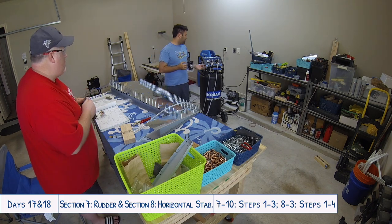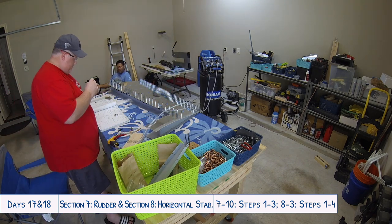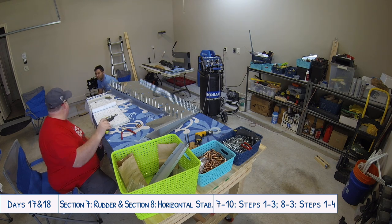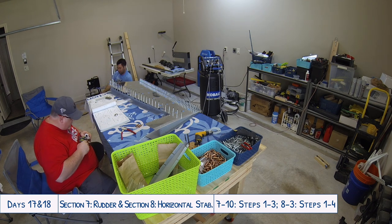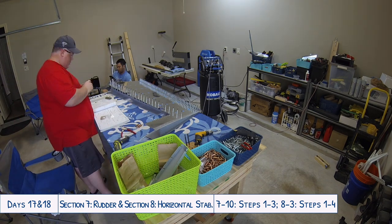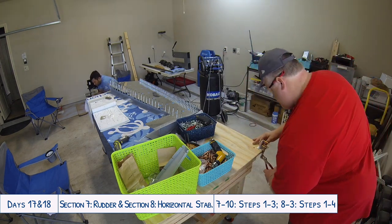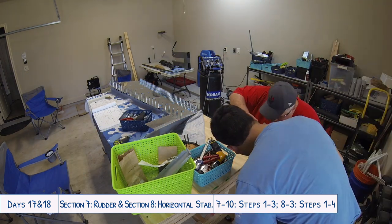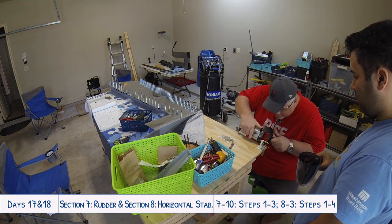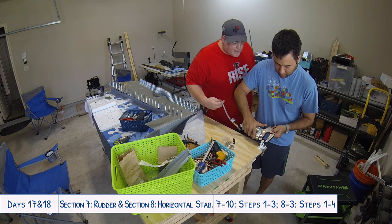As you can see there's somebody different in the video right now. We had our friends Ari and Sarah in town visiting and they'd heard about our plane, so we had them come out to the garage. I had taken off with Sarah to go to the quote-unquote aviation department at Home Depot to get the blind rivets we needed to fix the problem from the previous video on the rudder. While I was gone, it gave Tyler a chance to work with Ari on the inboard hinge bracket assembly for the horizontal stabilizer, showing him the different tools and even getting to install a rivet on the hinge bracket using the pneumatic squeezer.